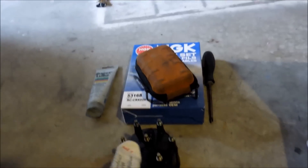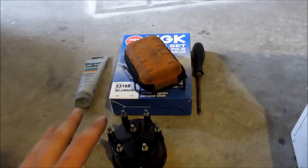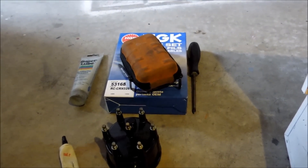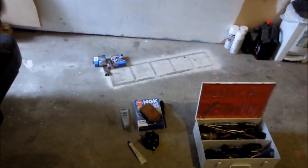I've already pulled them out to make this easier. What I like to do is make sure the plug wires go back in the same way: unplug each wire one by one and plug it into the new cap. Look for the screw holes, because that's the easiest way to orient it. For mine it's going to be a little bit different — I'm just going to transfer the wires right onto the cap like that.